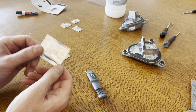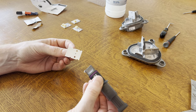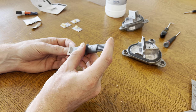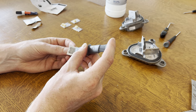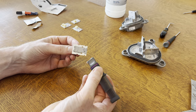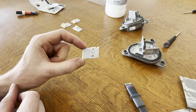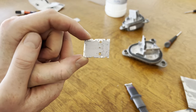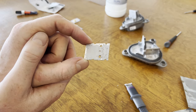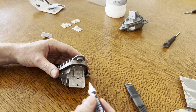We're first going to use the supplied grease cleaner to perfectly clean the board, then carefully apply a thin layer of thermal paste. That first attempt was terrible — let's see if I can spread this better. This is what I finally made of it. It looks like it's not pretty, but it's probably functioning. So let's go ahead and apply some super glue to the heat sink and continue. We're only going to use four very small drops and that's it.